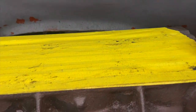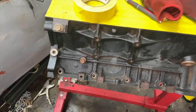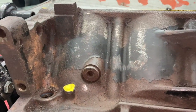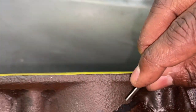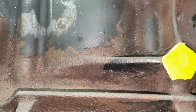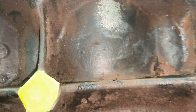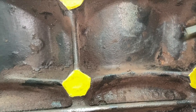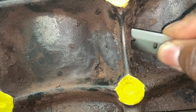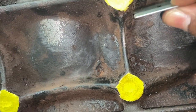As you can see, I started taping off my deck surface — I cleaned that up a little bit on both blocks, the 6.0 and the 5.3. I'm starting to go over the block, and you can see paint right here — all this right here — I'm trying to get that off. I got loose paint all over; I want to make sure that's off. Prep is everything, man.